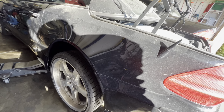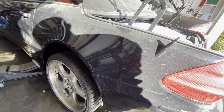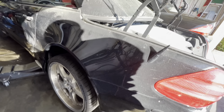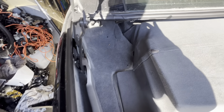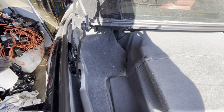And there's a torsion bar. There's a bolt that you have to remove. And, of course, the bolt for the lower part of the strut. Three bolts. That's it, guys. That's it. Three bolts down there. You know, the lower control arm, whatever. And two nuts on top to drop the strut. That's all you got to do. It's that simple. All right?